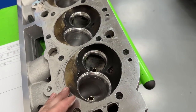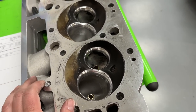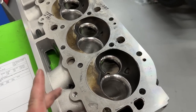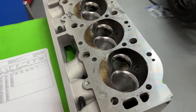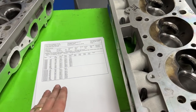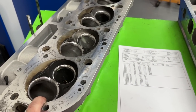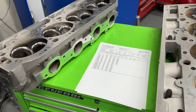So I'm not fully porting the head, just doing a little bit of work. The throat is going to stay the same; I'm just doing a little trickery — making the bowl a little bigger and definitely reshaping the short side. The 317s are only getting blended; no port work at all. A little bit of port work on this one and blending — see if it can match the 317s' power and torque. But with the 317 getting a smaller chamber it's going to be a good race anyway. All this was flowed on a 4.310 bore, no exhaust pipe. Hopefully we'll get back on the dyno and try all this stuff out. Still need to cut the valve job on this one to the 2300 intake — but guys, thanks for watching. Remember, I'm no superman; if you have questions or comments please put them in the comments. Take care.